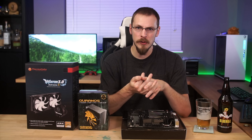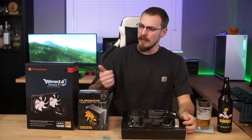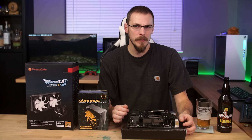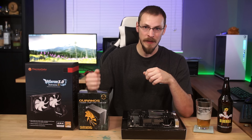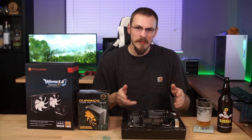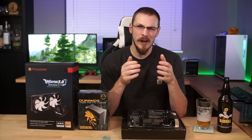Regardless of performance metrics, there are tangible benefits of going with an air cooler over an AIO. If the pump gives out on your water cooler, there's no backup — the CPU block on its own doesn't dissipate much heat, and without water movement you could quickly reach thermal shutdown. Air coolers have a much lower likelihood of failing, and even if a fan dies, the tower still provides some cooling thanks to airflow from your case fans, giving you time to shut down properly. Before installing this board into a case, I'm testing both coolers on my open-air test bench — otherwise known as the box the motherboard came in.